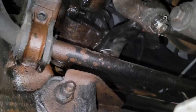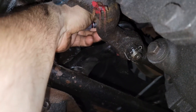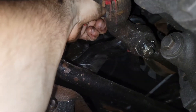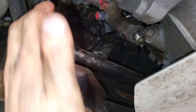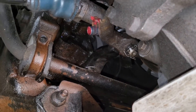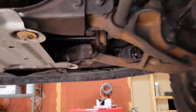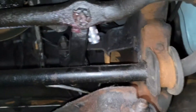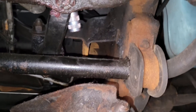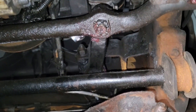For your pitman arm, we're going to use a 90 degree angle fitting. We're going to reach up all the way over and put it on. Now we're on it — take the lock and lube, attach that, and just pump grease in. It's really hard to get the lock and lube up and around and down, so the 90 degree fitting is a big game changer here. For the idler arm, push it so the arm itself is just a little bit off center, which puts your wheels just a little bit to the right — that way you can fit the 90 degree angle fitting on there. If you don't do that, the fitting will run into the bottom of the engine. You can sneak the lock and lube on depending on your vehicle.